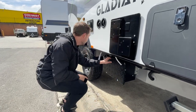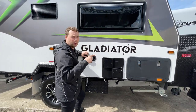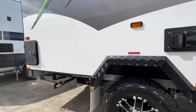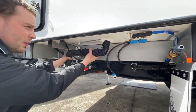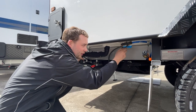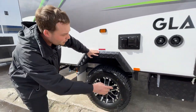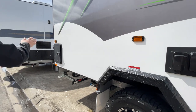We've got 16-inch tires. We've got a 28-litre gas and 240-volt stainless steel hot water unit — no anode, no maintenance whatsoever. Two 95-litre water filler caps, as well as a grey water tank underneath, with all bash plate protection. We've got empty valves, grey water tank outlet, and wrapped conduit pipes. Quick fill main system — you plug your hose in, you don't even have to use those side fillers; it's going to suck water straight into the tanks. We've got mud flaps on the back, bash plate battery protector, mains plug, fuse panel on the back, and side markers all the way across.